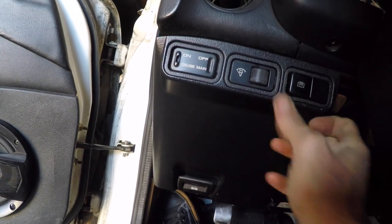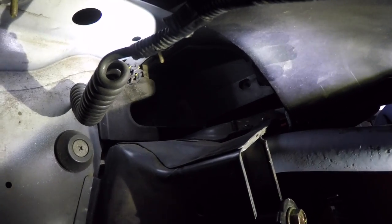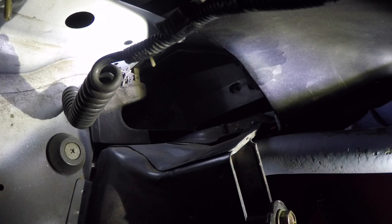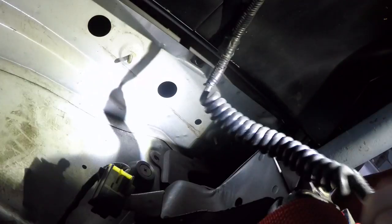Also, if you're doing this on a soft top, there's a switch up in there that will tell the car whether the soft top is down, so you can't turn on the defroster with the top down. If that switch is damaged or isn't grounding properly, the car is going to think the top is down and the defrost won't come on. So if you have everything connected, checked all the fuses, and the defrost still won't come on, check that switch right behind the driver's side seat where the top folds down. You also need to make sure the pigtail to your hard top is connected — connect it here.